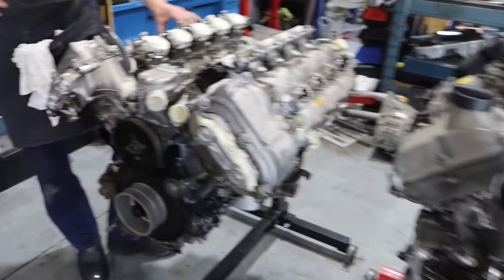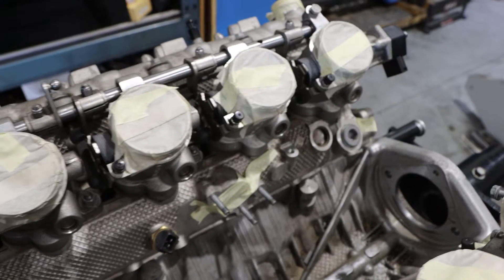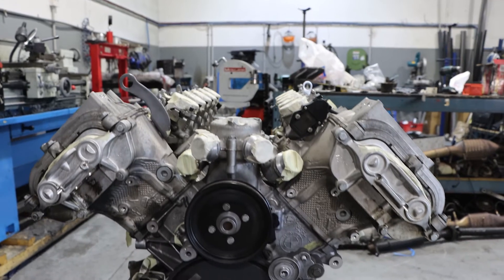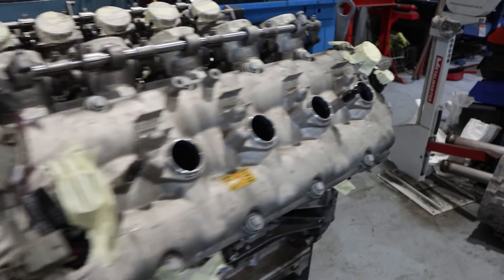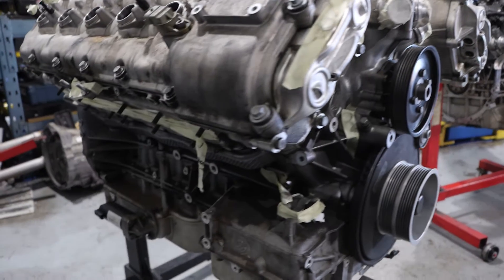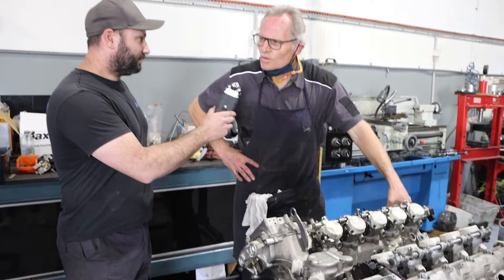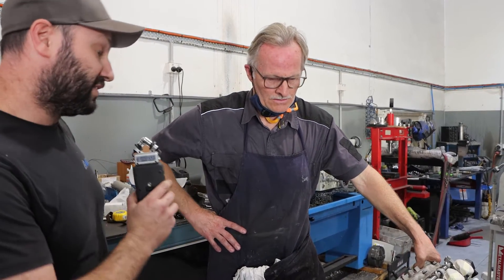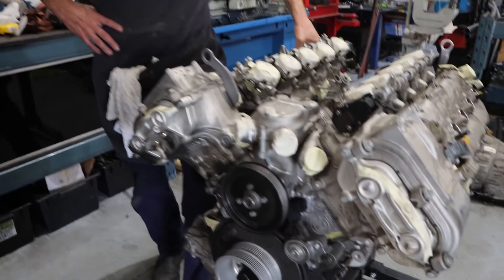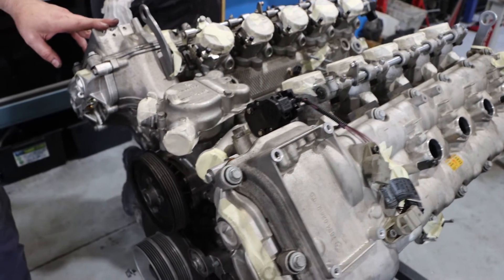And lastly, we've got the S85 B50 — this is a five-litre V10. Again, individual throttle bodies on the top, five on each bank. Good comparison to the Audi or Lamborghini 5.2-litre V10, but this thing makes about 30% more than that engine naturally aspirated, and it's only a five-litre. This is a very impressive engine and it revs to 8400 standard. From memory, this won engine of the year awards when it came out — the design and structure of this engine was a winner. This is a 2004 model engine, so it's been around a while. It only lasted about five or six years in production cars, but it was way ahead of its time.